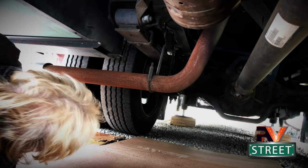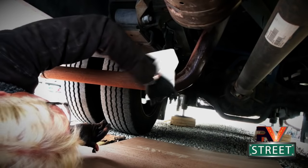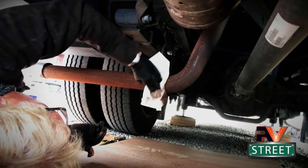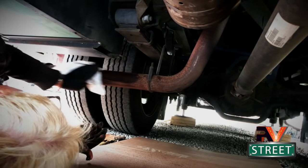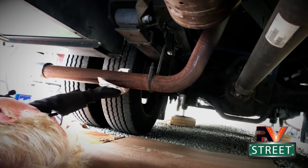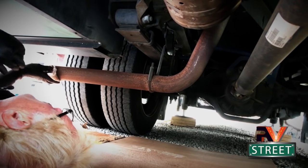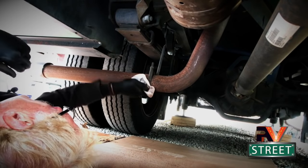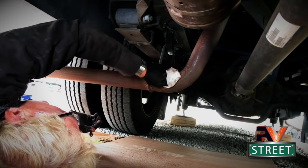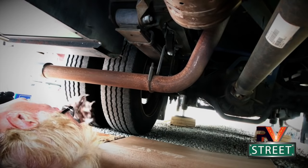As you can see, I did not have to take all that rust off down to bare metal - you don't have to do that. I just lightly sanded it to get a little bit of that surface rust off, and now I'm using acetone to get the dust off. This is the beauty of this Permatex product. When you have real heavy serious rust that requires POR-15 or something like that, you have this endless labor. But with this Permatex, not so much. So we're done here, let's go to the next project.